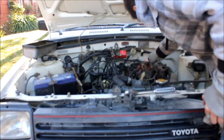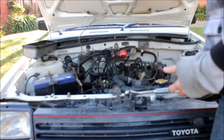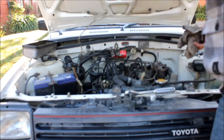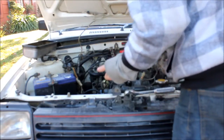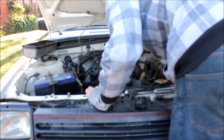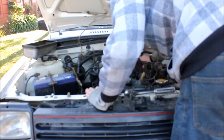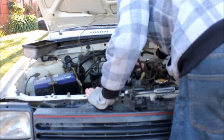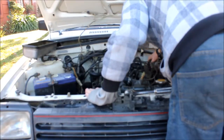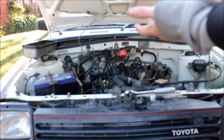I did discover there has been a slight oil leak at the back of the valve cover, and that is a fairly new gasket on there. I think I might just not have it quite tight enough. An important tip: do not over-tighten your valve covers, because that's a really good way to make gaskets leak — you crush them. It wasn't a serious leak; I haven't lost any oil over an entire oil change period.